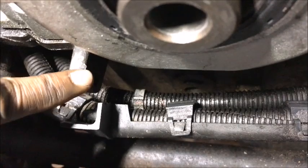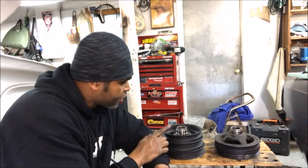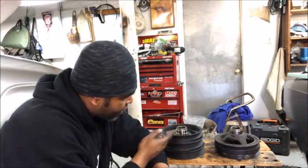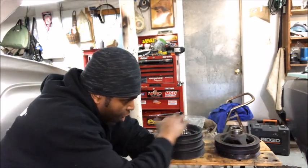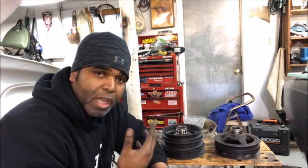If you're using a stock LSA pulley and the front of your oil pan has a wire management like this, you're going to have to trim it. Because as you can see, that's where the harmonic balancer was hitting. This is your stock LSA crank pulley and this is the crank pulley I pulled from the Trailblazer SS. You can tell they're a little bit different — same height, so it's not going in any deeper, it's just got an extra groove. What was happening is this lip right here, which is not on the other one — the offset is totally different — this lip was hitting that wire management.